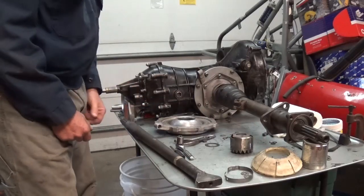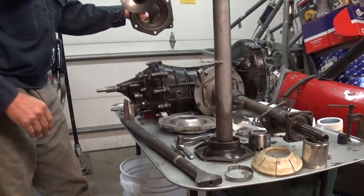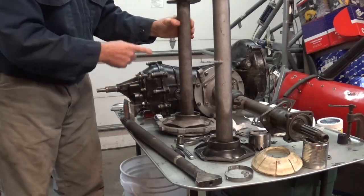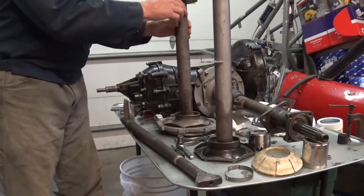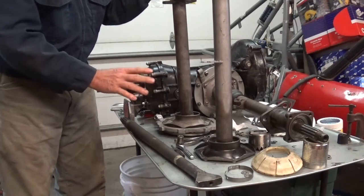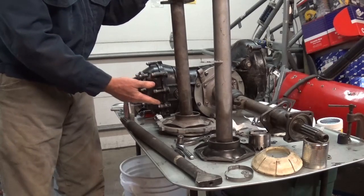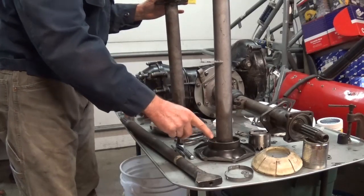These have to fit against the side like so. You don't have a CV joint with a swing axle — this is how you get your up and down wheel action, it's more of an arc. Some people think they can go a greater distance than what the factory allowed, and probably to a certain degree there is, but you're not going to get the same amount of travel you do with a CV joint, and these aren't indestructible. This is the one I was trying to make fit and it didn't.